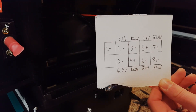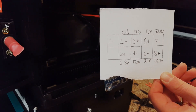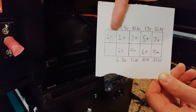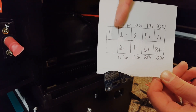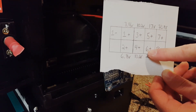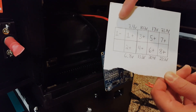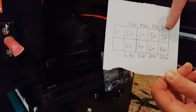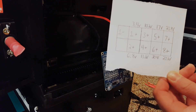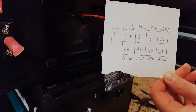You need to decide which pin you want to be which cell. In my case I'm going to wire it from the top left: main module negative, first cell positive, then two, three, four, five, six, seven, eight in that order. You can do this any way you want — totally up to you, which is one of the cool things about doing it yourself.